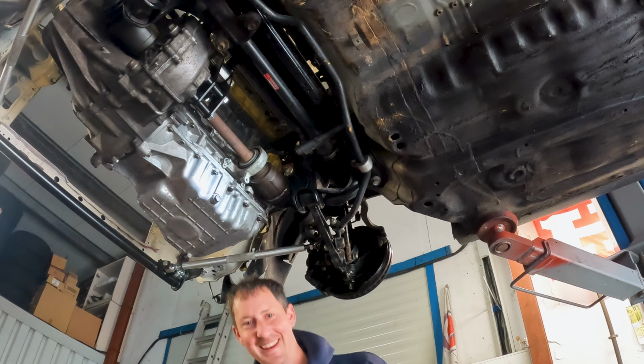So, if you're doing this swap and you have trouble with your drive shaft, you have an EE8 chassis like me, and you put a K20 in there, which is already a pain in the ass to begin with, here's what you need on drive shafts. That's how it was in my case. I hope it's the same in yours. You need to buy the right side EP3. That drive shaft goes on the left side, which is right here. That is the left side from the EP3 drive shaft, which fits perfectly.